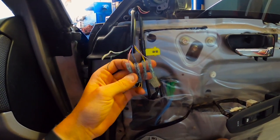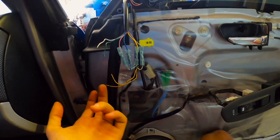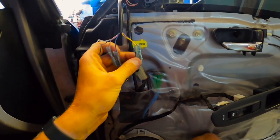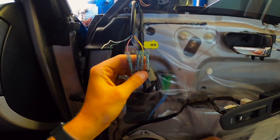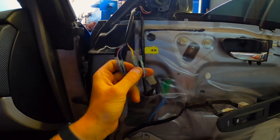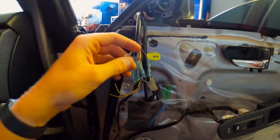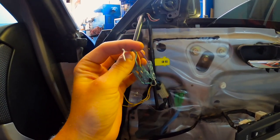The only complaint I have on this side is the horizontal — so up and down. When I do it on the switch, it's kind of backwards for some reason. When I press down, the mirror goes up; when I press up, the mirror goes down. On the forums it said that this was like normal — not normal, but there wasn't really a fix for it. So we're just going to leave it like that because I honestly never adjust my mirrors. I just wanted to have it. The green and white are for your turn signal and we will be doing that in a later video.